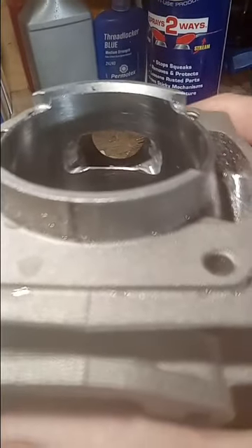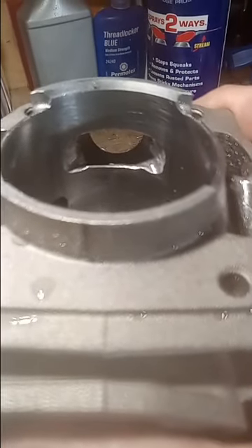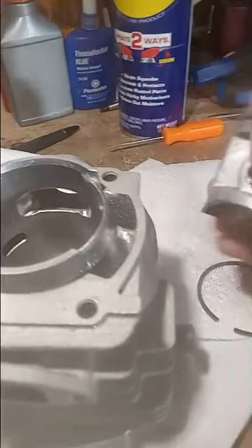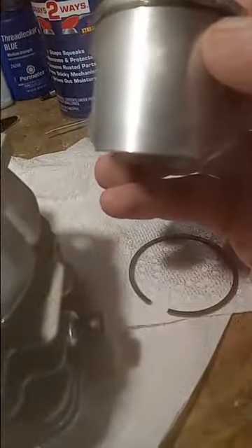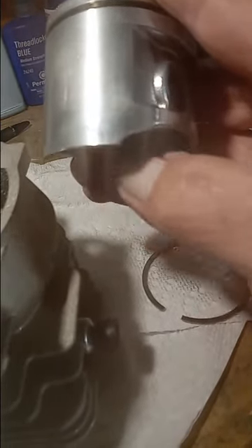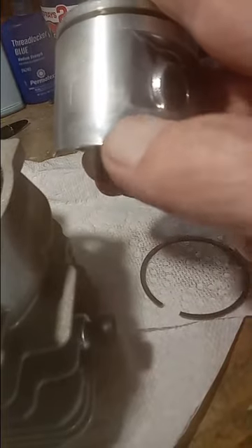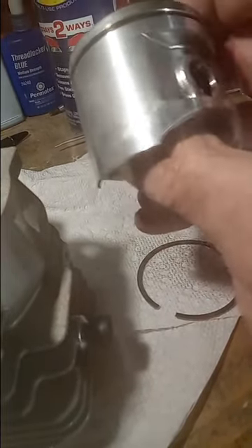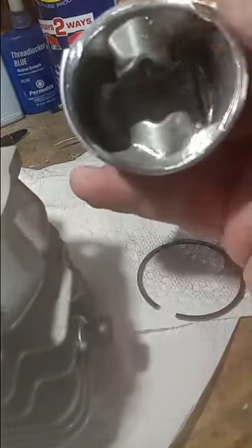I'm doing some tricks — you can see the notches I did on the intake. I widened it just a tad bit. Other than that, I've been cleaning up the stock piston. You can see these sharp edges on this side — this is the side I haven't touched yet. I'm trying to get rid of that and smooth it out, and also take some weight out of the piston.